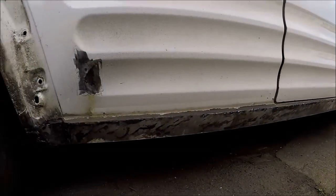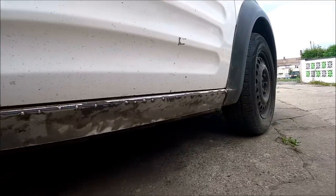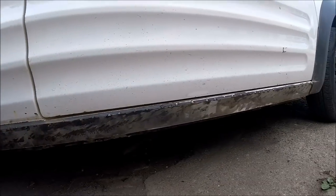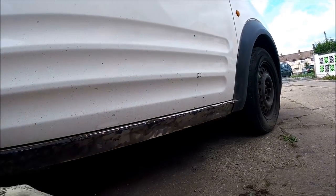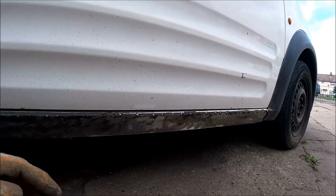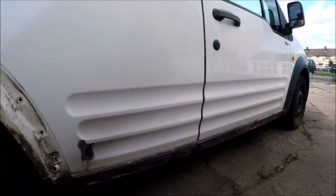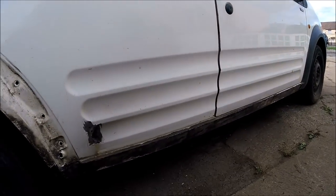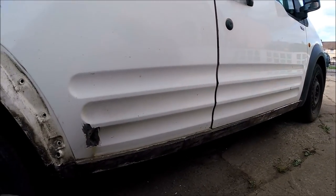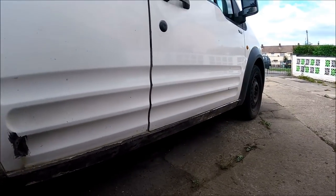That's all of the surface rust off the sills taken back — it's gone back to good metal all the way along. You can see where it's been previously replaced; you can see all the spot welds going along. So now all of the surface rust that was starting to accumulate again has been removed. I'm going to smother the entire sill with some rust remover first, then some rust converter. Then it's going to get stone chip guarded, just to be sure, and then it should be future-proofed for many more years to come. That's one side all ground back; I'm going to get the rust remover applied, and while that's doing its thing I'll crack on and get the other side sanded down.